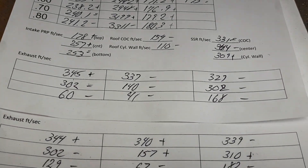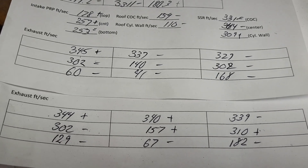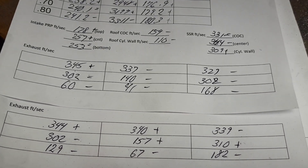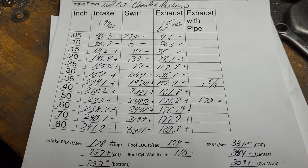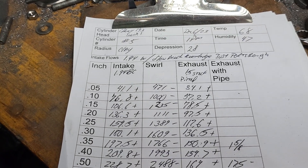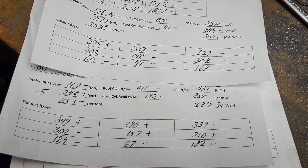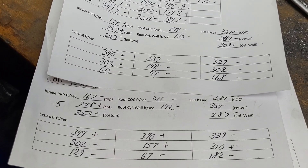The airspeeds tell us a lot. Second cut is on top — from left to right we got a plus, but only one, then equals, then minus. The floor really died, the middle is minus, minus, minus — dead on the floor, dead right in the middle, and on the right minus, minus, minus. According to the airspeeds the whole thing is a negative, but at 500 this was flowing 171.2 and this one was flowing 169 — almost the same. De-shrouding that exhaust was not a big addition.